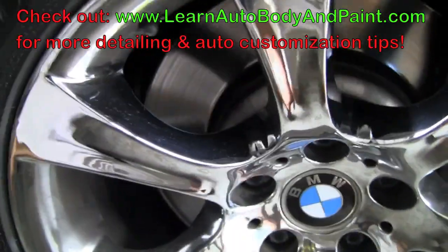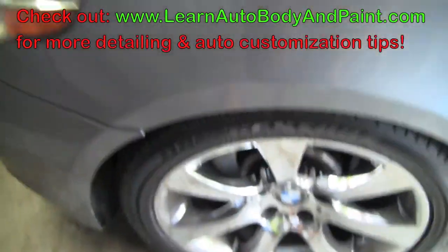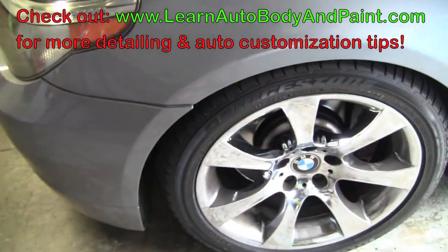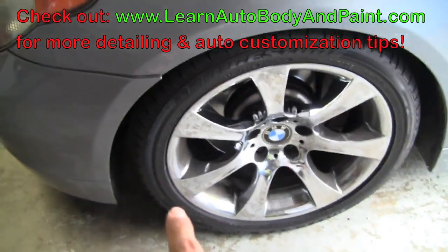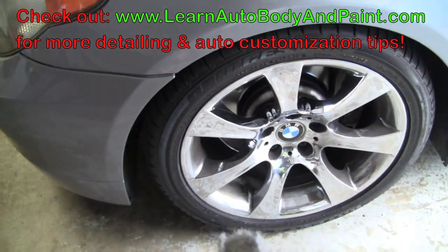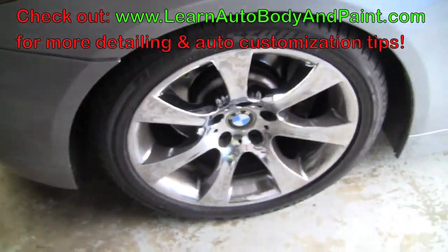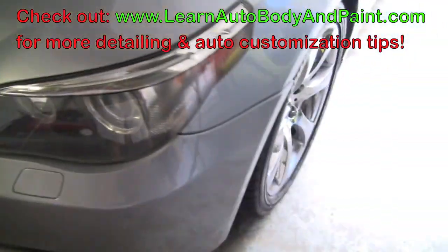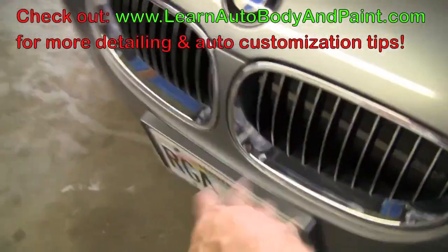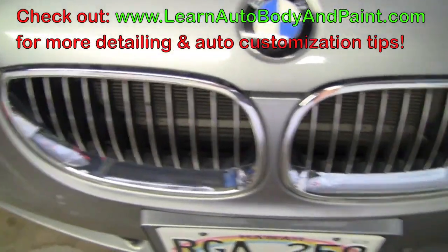Make sure you use this technique. It's a very, very good way to clean up chrome without using compound, because compound does take a little while to work. The only drawback is you have to make sure you rinse anything you do off with water. Because if you don't, it will rain outside and this is going to create particle dust all over your rim. You're going to get surface rust on all the particles left over on your rim or whatever you're working on. So just be sure to take it outside and hose it off with water — especially the front area we just did.